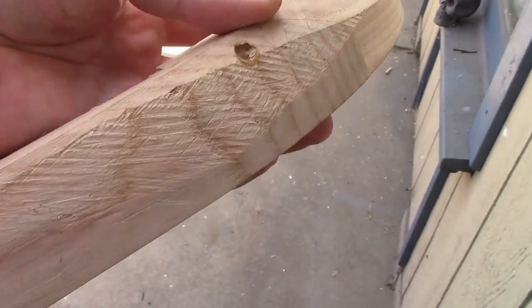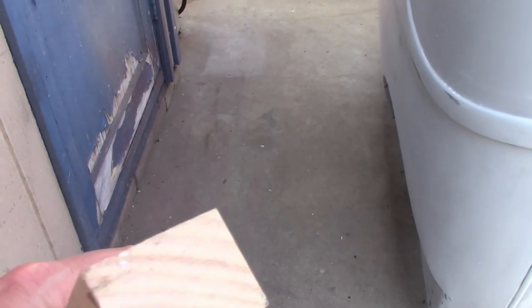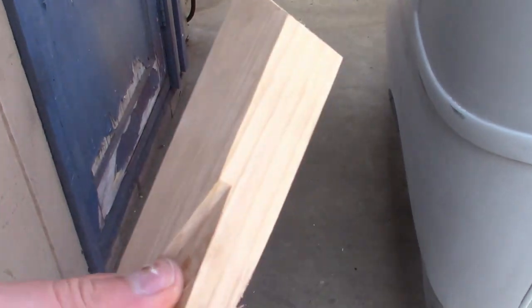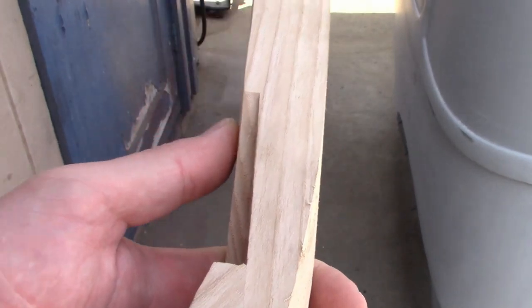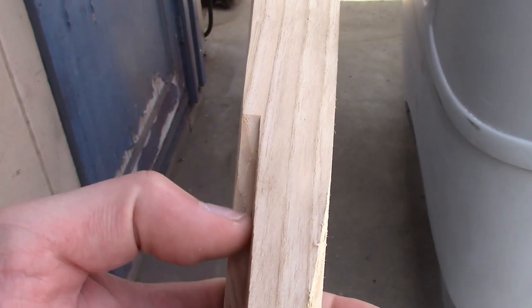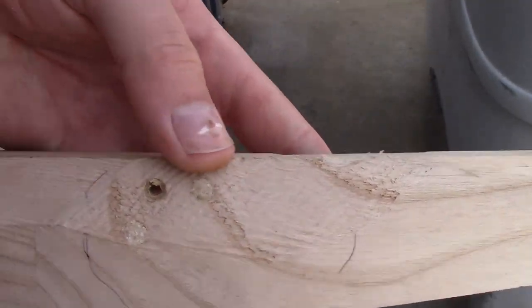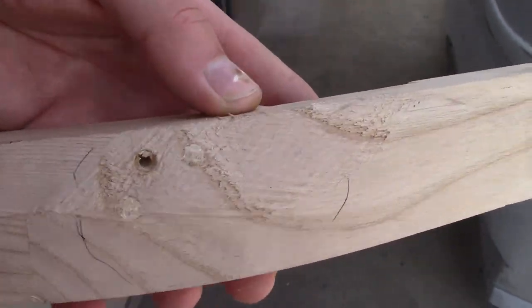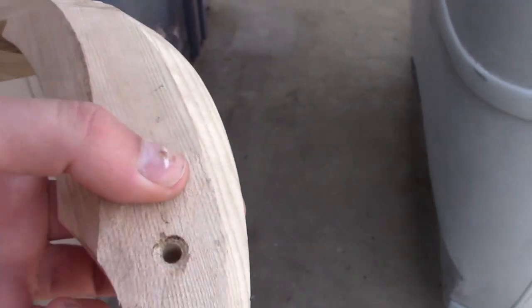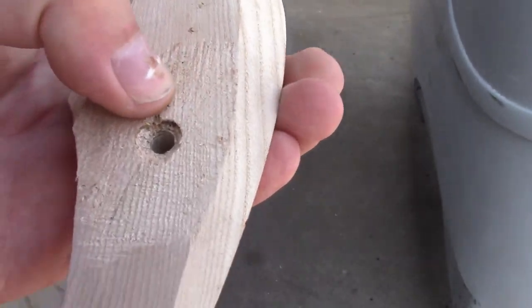For the right side I had to cut a little bit off this end. The groove for the tack strip was the same depth, but this one sets inside further so it wasn't a problem. I also had to trim a little bit off on the outside in kind of the same location on both of them. The mounting hole lined up perfectly, which was surprising — I did have to countersink it a little bit, but the hole was in the right place.